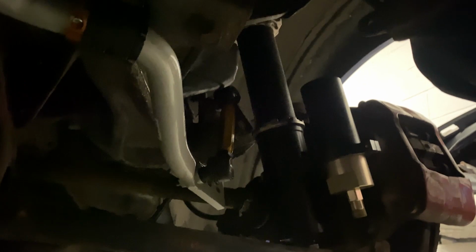Yeah boy, starting to look pretty good now. External reservoir coilovers, Whiteline drop links installed. Torque them up, 35 foot-pounds. That's the official torque spec for them. Painted up the brackets, got the locking rings on, goes over then, and then the same on the other side.